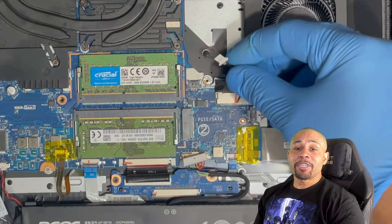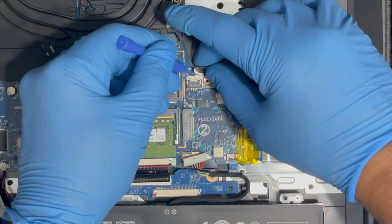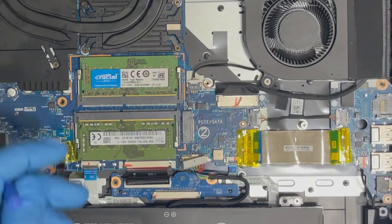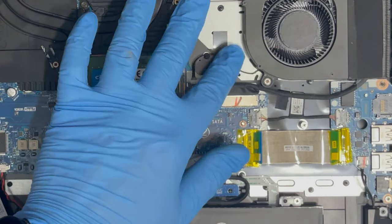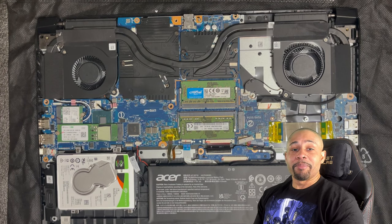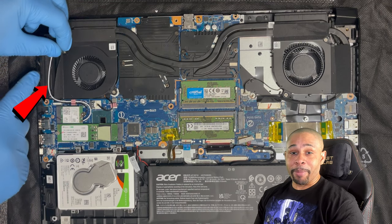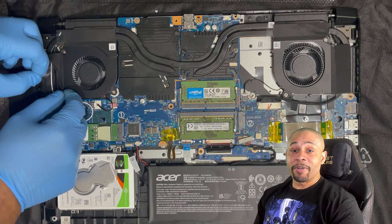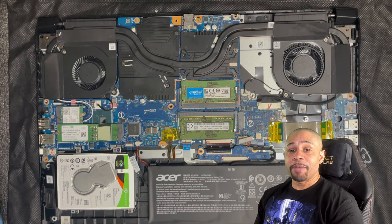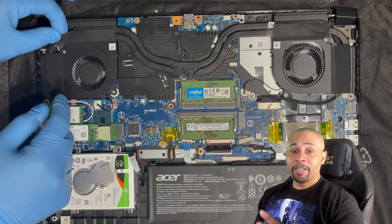And let's do the same thing on the other side, which is the CPU fan. Going back to the other side, make sure the Wi-Fi cable is in the groove before removing the plastic backing to the tape. Once that is confirmed, remove the left backing to the tape and gradually lay it flat. And do the same for the top.